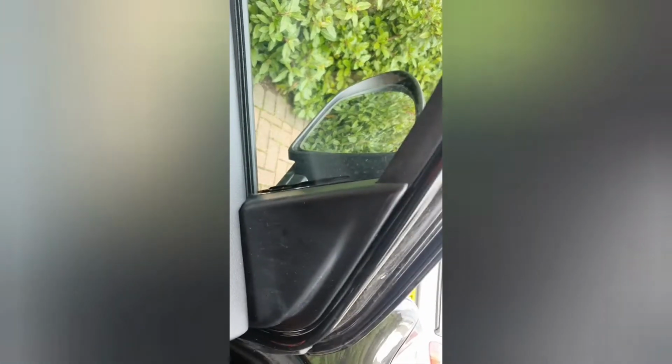I tried to go straight in there and lift up this panel, but I couldn't do it. So what I've done is I've started off with this pointy one here, just into that corner underneath. I picked the side which can't be seen, just in case you damage your trim. I force it in just into there, and then I use a little bit wider one once it's opened a little bit more. I start in there just in a small edge, and it deflects the trim enough to get a little bit wider in, and as you can see I just work through the series of these until I'm on there. It takes about half a minute. And we're going to lift this off now.